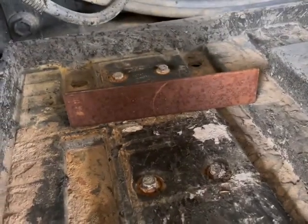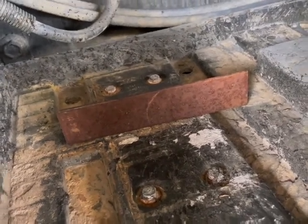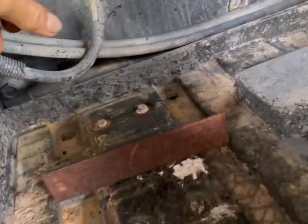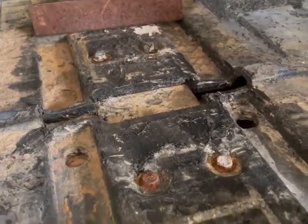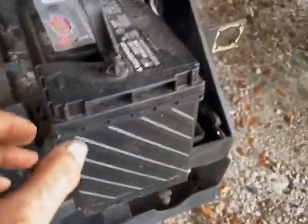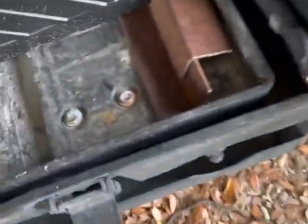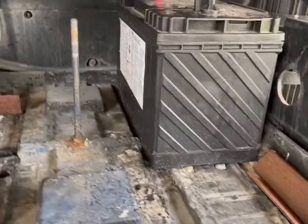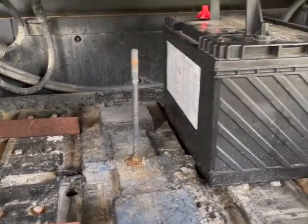What I'm going to be doing next is setting up side-shifting stops as wide as the battery. I use a sheet metal screw — basically a wood screw, whatever you want to use; a plastic screw would probably be best. Drill a couple holes and set those out. Remember you've got tanks underneath — you don't have to go wildly deep; some of it's thick, some of it's thin. Just to show you the Group 31 sliding in here — yeah, that's basically what it looks like. You've got somewhat of a stop down there from a ridge you created.